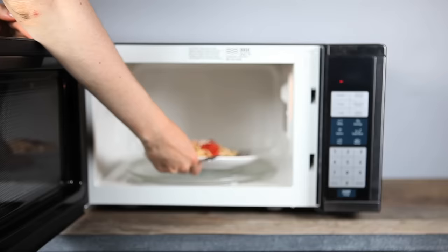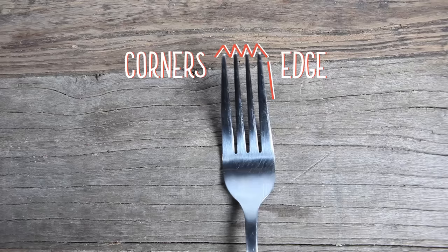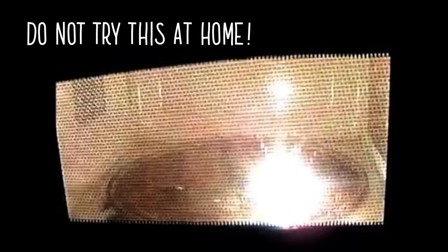When you're cooking food with metal in the microwave and you see sparks flying, that means there's been a buildup of charged particles. The oscillation of the microwaves produces a concentrated electric field at corners or an edge of a metallic object. When these particles are pushed by a voltage that changes radically over a short distance, the buildup of electricity arcs, resulting in the flicker and flare of sparks and that familiar popping noise.